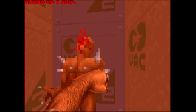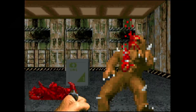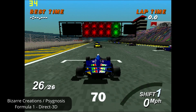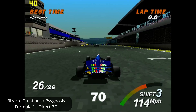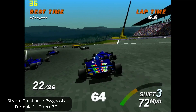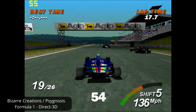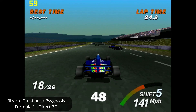The VIA EPIA-ML Mini-ITX board is an interesting and flexible retro part. It is low power, completely silent, and total system power draw never exceeded 35 watts during my entire testing — measured from the wall, even when fully overclocked. No fans are required, and it can play a variety of newer and older DOS games, plus some 2D, early Direct3D, and OpenGL Windows 98 games too. There are some limits — the integrated CPU is close to Pentium II era in performance and roughly Super Socket 7 era for the FPU, so Pentium II era games may result in low numbers. The Unichrome IGP is very weak, lacking hardware T&L and heavily restricted by memory bus bandwidth. Expansion is limited to the one PCI slot unless using a riser or alternative case.